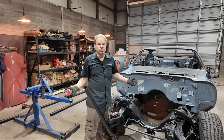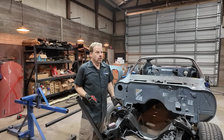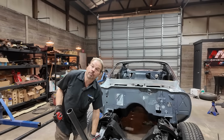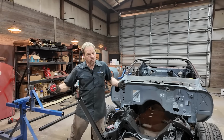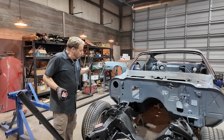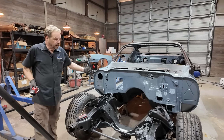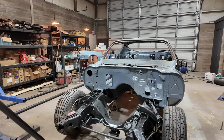It's important to do this when you're aligning your stuff for sure, for real. Because your fenders mount to the radiator support mounts to the subframe mounts to the body, and if you've got a discrepancy, it can be hard to line up your sheet metal, and can cause you handling issues and tracking and all that kind of stuff. So we're good. So I'm gonna run these bolts in, and we're just that much closer. I am loving this.